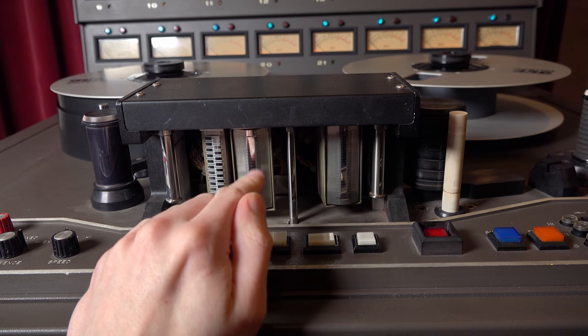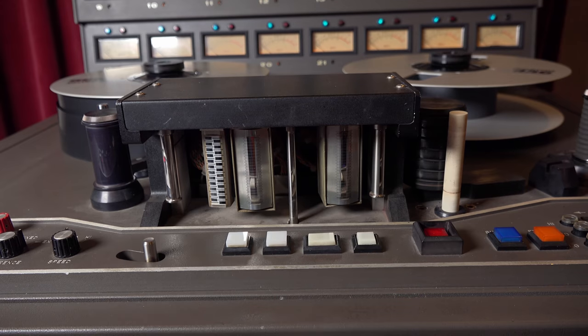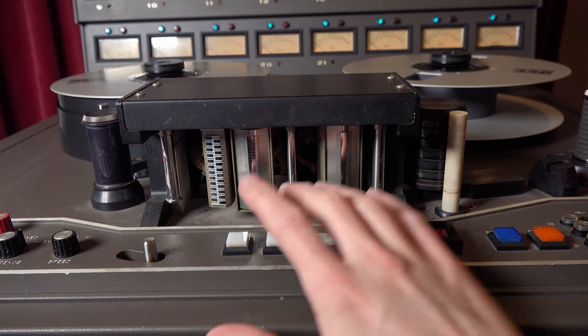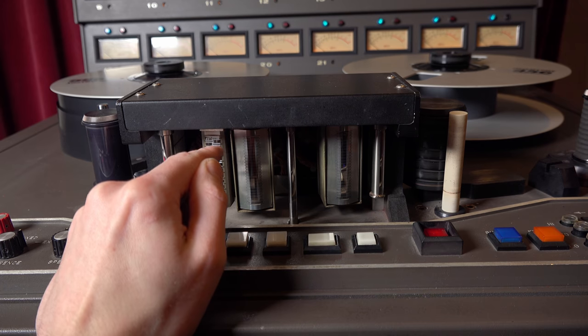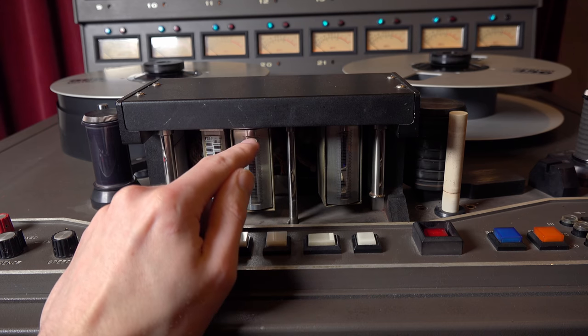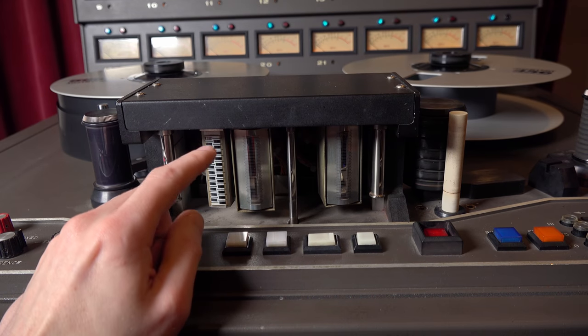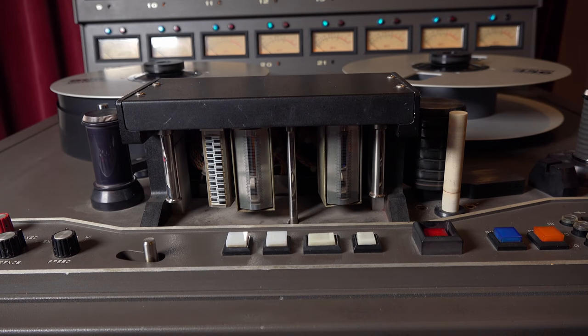The recording head writes to the tape but can also play back — more on that shortly. The last head is the playback head, optimized for high-quality playback. There are two issues: first, when you hit record, the erase head starts clearing tape before the record head writes, so if you stop, it may erase a bit too much and create dropouts. This machine has a system that delays activating the record head just enough to fill that gap.